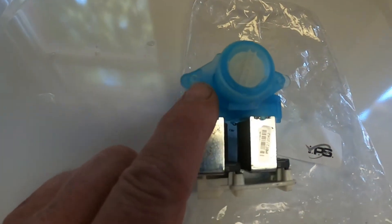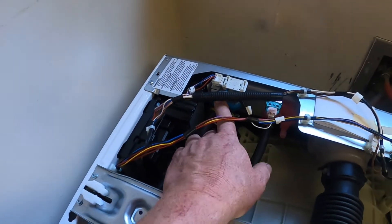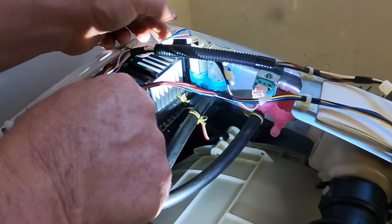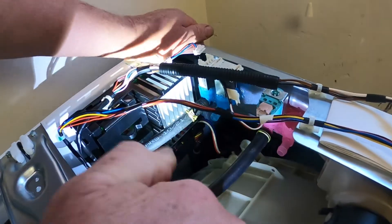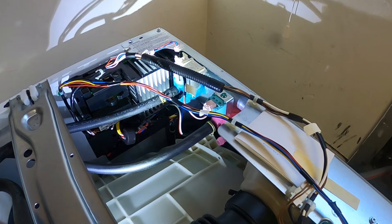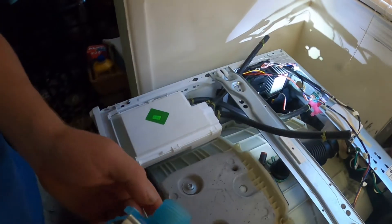You can see it's got a place for the bolt hole here, so this valve sits in there and screws into that hole, then slides out. I've got my needle nose pliers, pulled the clamps back, unplugged the wire connection — you push down on this tab and it slides out — and I've taken the one screw out. Let's get the lines disconnected: there's one line, there's the other line. Now this thing just turns and comes out. There's the old one.